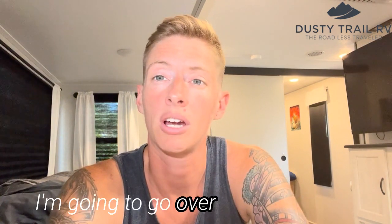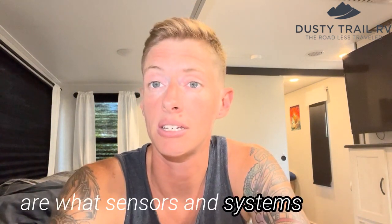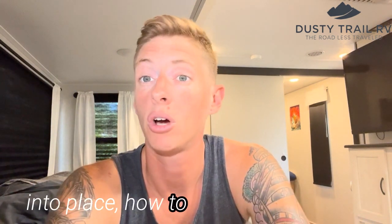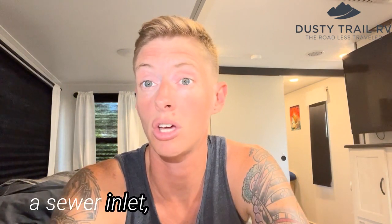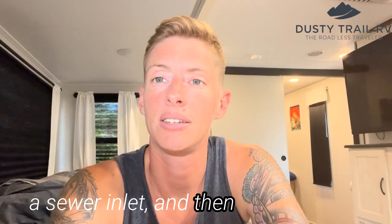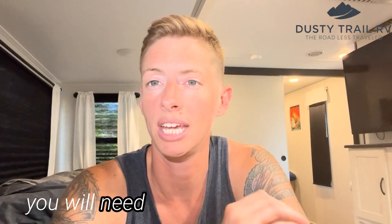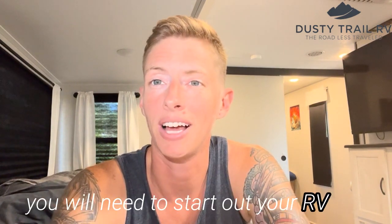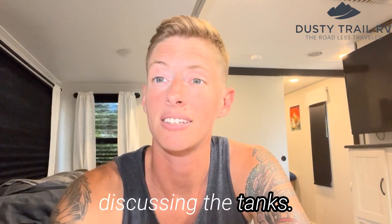I'm going to go over what the tanks are, what sensors and systems are put into place, how to hook up your RV to a sewer inlet, and then some hoses. And these are just the basic parts that you will need to start out your RV life. So let's start with discussing the tanks.